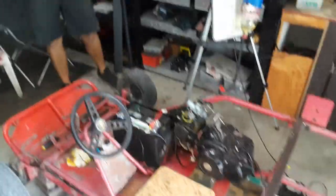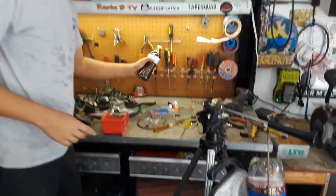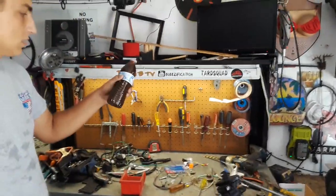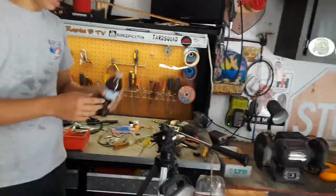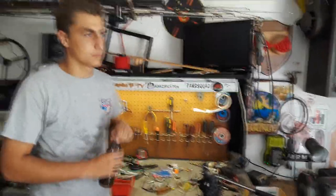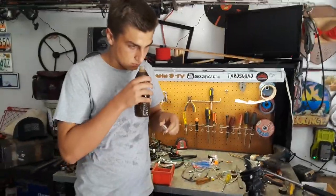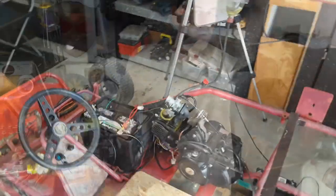I changed the oil. See what the oil looks like up there? That's the oil from this? Yeah. Don't shake it up. I was trying to let it settle. It's thin. It's like water and gasoline. Yeah. It smells like gas, which is a bad thing. Probably had to leak all the fuel down through it. Vapor lock it. Yeah. But that's all the oil. Fits in all right.